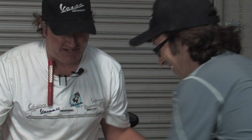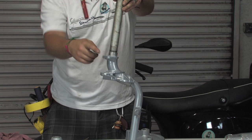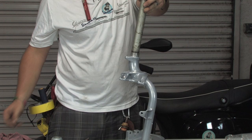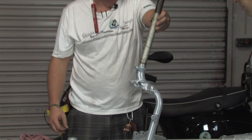You can see this cast aluminum knuckle — it contacts the stops in the frame and is what keeps the handlebars from over-rotating. It's very common to see a bike with a dent at the top of the leg shield because the stops are worn out on this knuckle or the frame stops are damaged and the handlebars rotate too far. This is the opportune time before powder coating to TIG weld that back up and reshape it. Always inspect those steering stops — if they're too rounded off, that's the time to get it fixed.